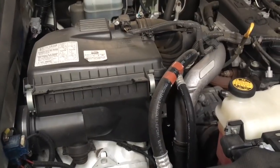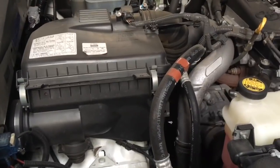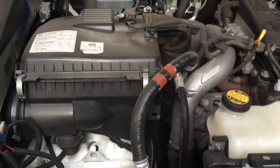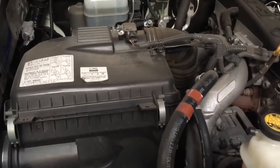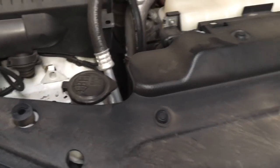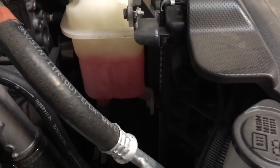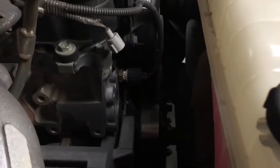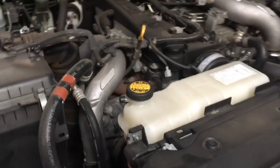If it's on-road only, the air filter just needs replacement every 30,000 k's — you can't really clean it. If it's been off-road with a lot of dust, it probably needs replacement anyway, which is why it's really a DIY thing. You can save money doing your own air filter and MAF sensor cleaning. Working around the engine bay, fill up your washer bottle, check your coolant level between the low and full marks, and check inside the timing belt cover for any water pump spray.